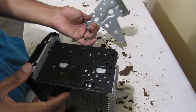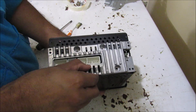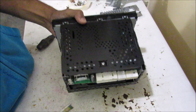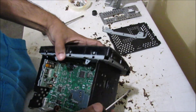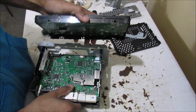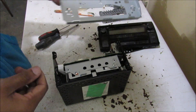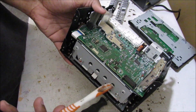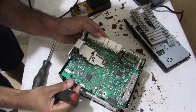I can remove the bracket. On the back there are a couple of Phillips screws to remove next. With all the screws removed, I can remove the heatsink from the back of the radio. There are a couple more screws across the bottom to remove the bottom panel. Then I'm going to use a flat screwdriver to pry up on the tabs — that's the radio face. A couple more screws to pop off the front panel, then a few more screws to separate the main board from the CD-ROM assembly. There's a little ribbon cable connector to remove, and then the board can be taken out.